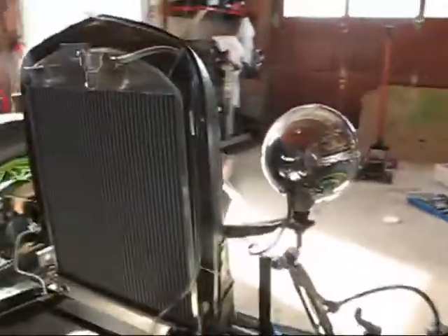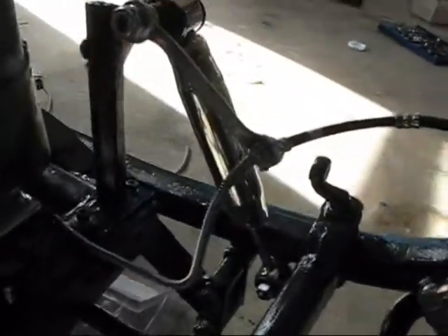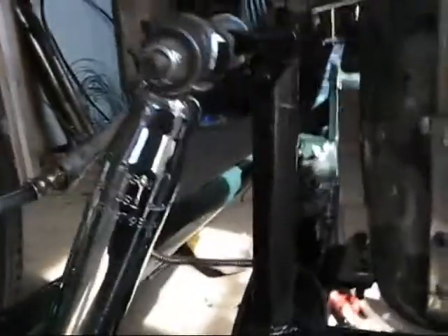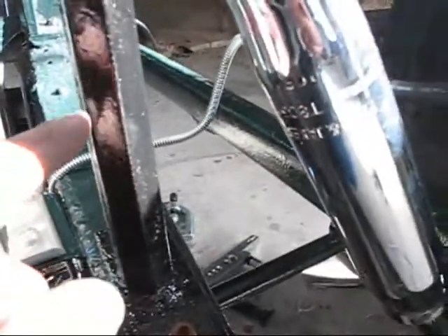The front brakes are in line. Here's where it comes out and goes down in front of the radiator - goes down in front of the radiator, comes across underneath on this bar, comes back up, and comes out just behind the radiator on the other side into the T.